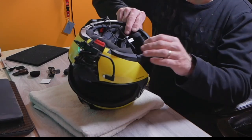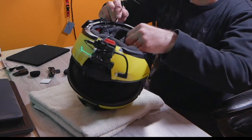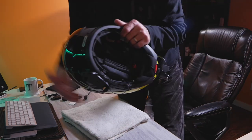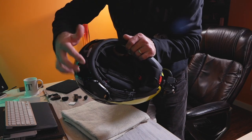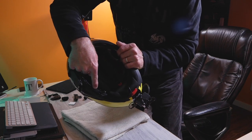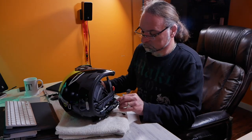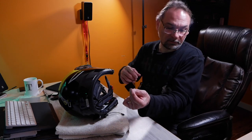Now all you have to do is reconnect your headphones — it's got a standard TRS jack, so just connect them and drop the cable inside the helmet. There's a little groove you can route your cables through so everything is out of the way. Be careful not to route anything near the visor cable channel. Next, think about where you want to place the boom mic — I'll cut it down in half because it's way too large.